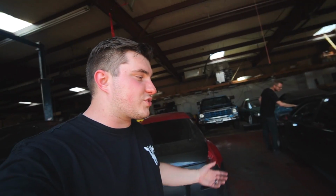We're at the point now where we maybe change a wastegate spring or something. We'll figure that out. But we managed the boost. We can rip some 11s on the street and now we can just tune it. We can just keep on messing with the boost controller and keep creeping the boost up. He can do some actual tuning at this point.